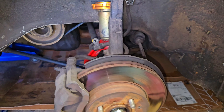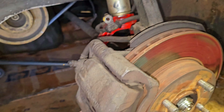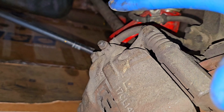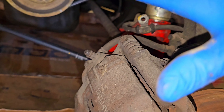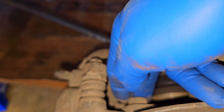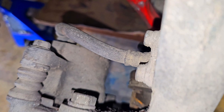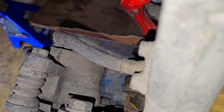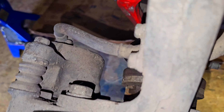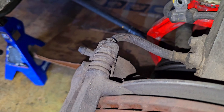I'm going to start taking all this stuff off. The first thing I like to start on is removing the two 10mm bolts that hold the brake line. You've got two 12mm bolts back here — one here, one here. You don't necessarily have to take them off now; I just like to do it because it's easier with the bracket already mounted onto the knuckle. There's another bolt back here, and one up top — that's going to be 17mm. And the other one is right down there, also 17mm. I usually like to break both bolts on the caliper bracket loose first, then start working them off.